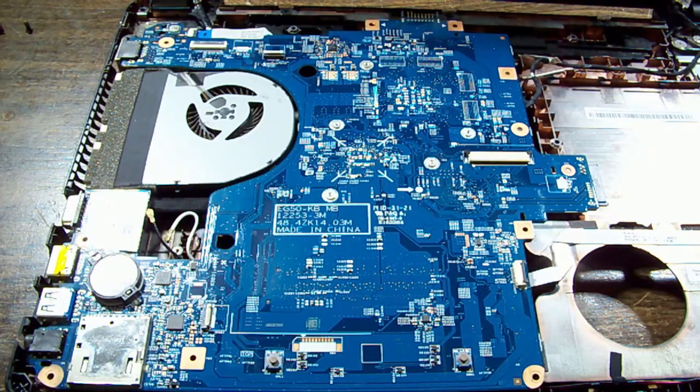I really can't see anything up close where it should be on the screen, so I'm thinking maybe we've got a cable fault to the screen that's not carrying signal - maybe there's a break in the cable. Or maybe an issue with the graphics chip. The sticker says Radeon HD graphics so I think it might have a separate chip. Not too sure how the external port is tied in with the internal LVDS.